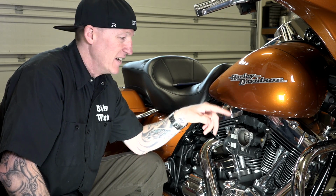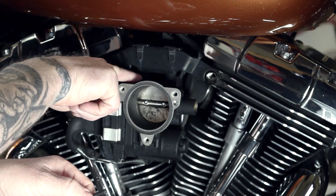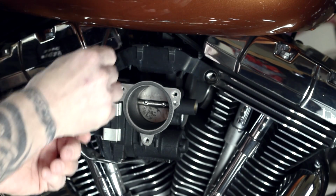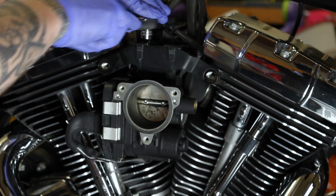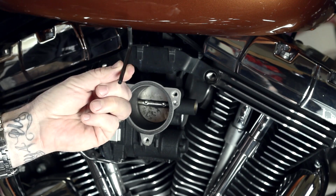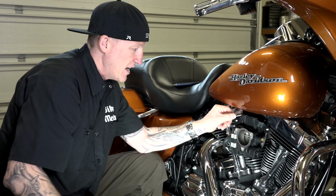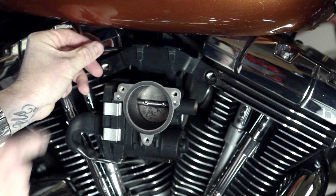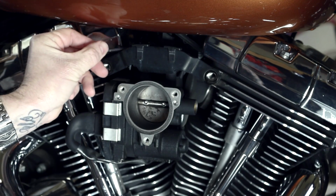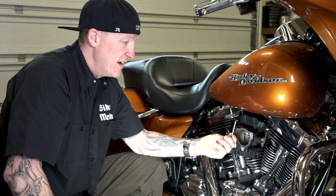The problem is, it's not a problem. You've got to remove the tank. A couple schools of thought on that too. There are guys that make a specialty tool. It's basically behind here. There's a bolt that goes down here. You can see the channels right there, and another one. You've got to get into it at the top. Well, this is a 3/16 inch Allen wrench right here, guys, so that way you know the size. You could try to get it up in there. It's really difficult. You're really not going to have enough play. You're going to get hung up. Even if you can get a little turn on it, this is not the way to go. It'd be a pain to do that.